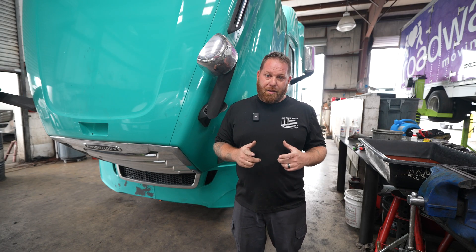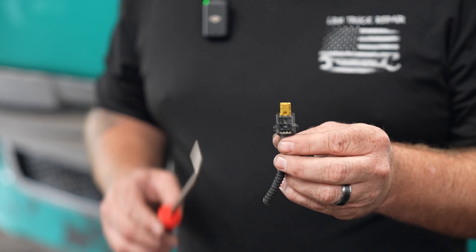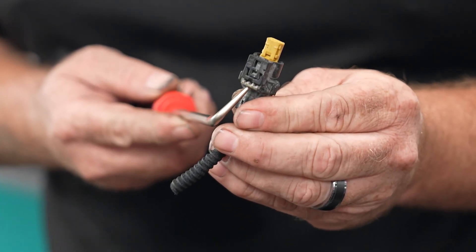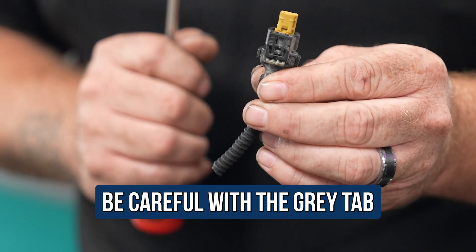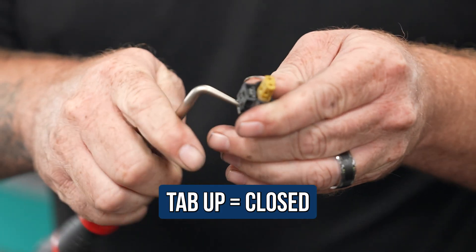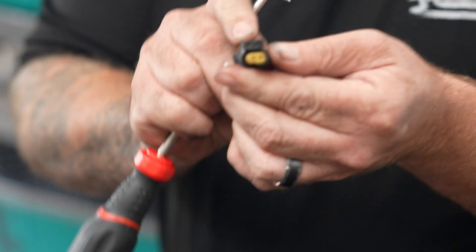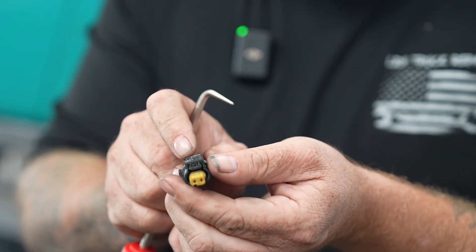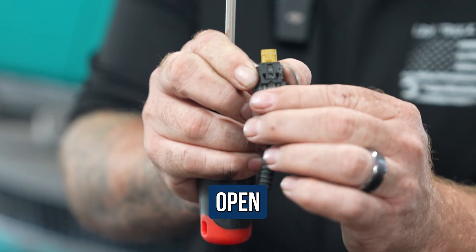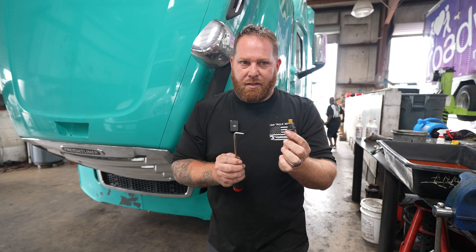I'm going to show you a plug real quick. The reason I use the pick is because where you have to reach in, it might be hard to take it off. This is not the plug that goes into your oil pressure sensor, but it's going to demonstrate what I'm talking about with the gray tab. If you're fighting on it, you'll break the plug and you don't want that. So this is where the pick helps — you reach in there, pop that gray tab open just like that. Once you have it open, just squeeze and the plug will come right out. If you're still having a little issue, use your pick to push this forward, then squeeze your finger and pull out. Just remember — that's closed; you are not going to open it at all. So just be careful when we start this process.